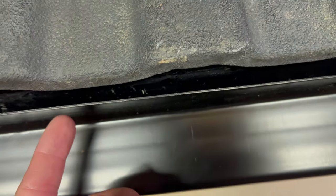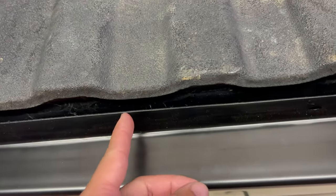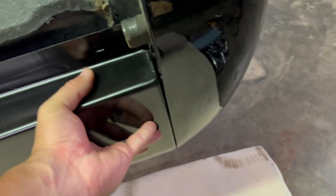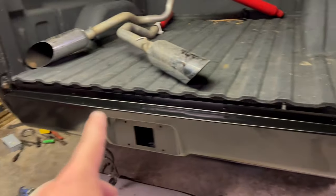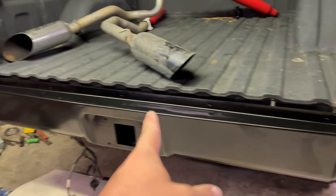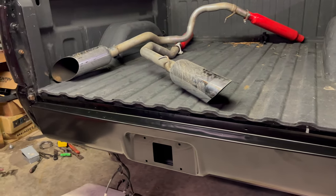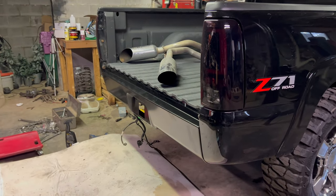There's a little bit of a gap right here, so when I screw this in, this gap is obviously going to close, which is going to push the bottom out. We will have to push the bottom and hopefully just bend this back and it'll line up, because it does line up really freaking good. Next step is to line it up with the tailgate on so we don't have an unequal gap on either side. We also want to close the tailgate, open it, make sure everything doesn't hit, and then we will mark our holes — one, two, three, four, five. Little drill, throw some self-tappers in there, and then we'll have to worry about lining the bottom up. I'm stoked because it's a gloss black and it's looking pretty freaking sweet.